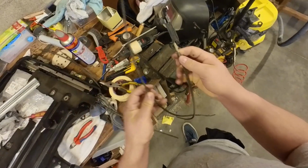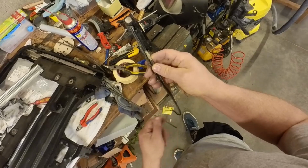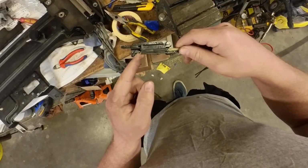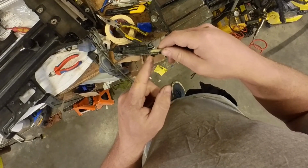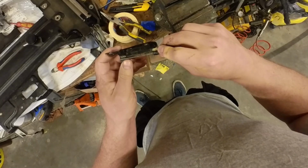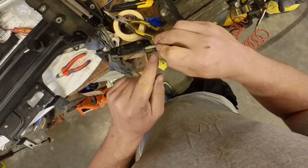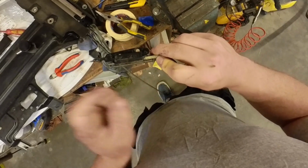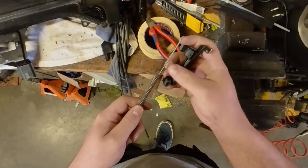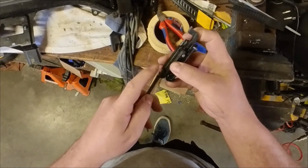And I think I did not remove enough, of course. Oh no, I didn't cut off enough. The old crimp connection was here where I cut it, and I only removed that section. So I didn't remove enough. I will have to remove the extra crimp connection here. Damn it. So I've exposed some extra of the inner wire. Now it should be long enough to fit the crimper in the front and the back.